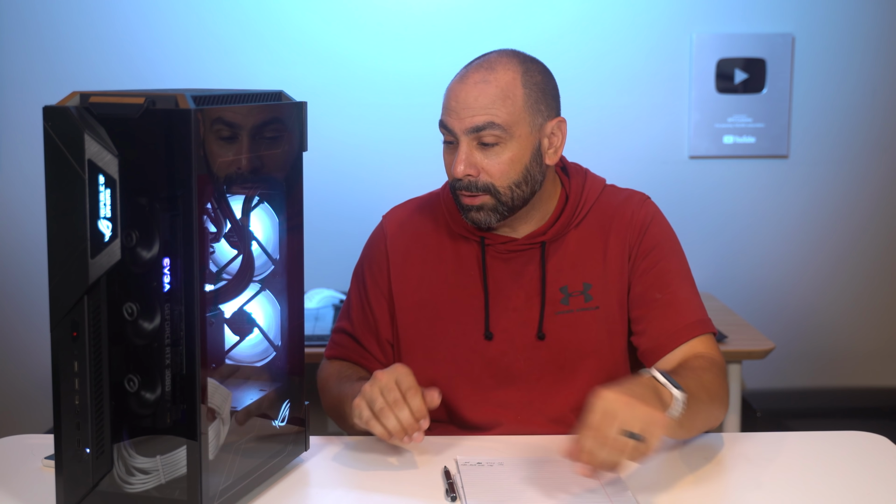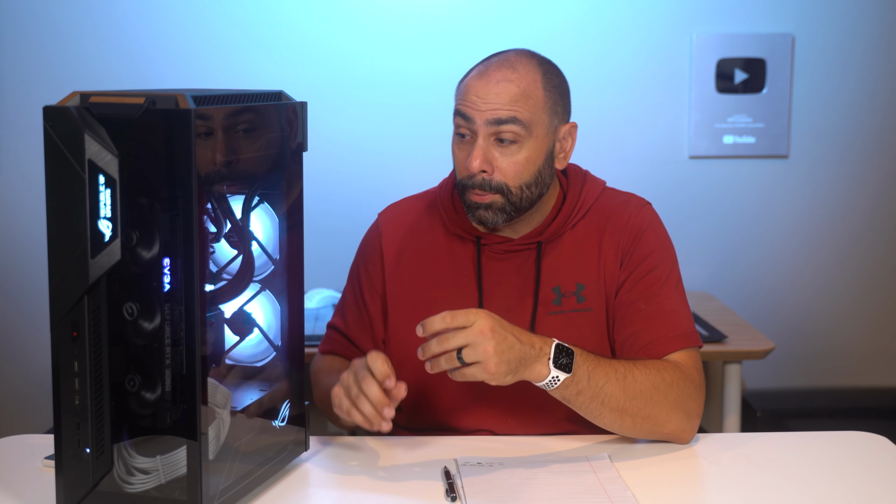Also, routing cables presented a couple of roadblocks for me. I kind of cut my hand one time trying to work around the graphics card at the bottom. And now maybe that's a matter of planning, you know, putting cables through first before installing the graphics card. And that's understandable, I guess. But I ran into it in other places too, where there are appropriate cutouts for routing everything you need to. But they are often either partially covered up or very hard to reach once you have some things installed, and it becomes challenging working in such tight spaces.